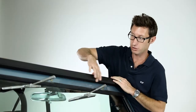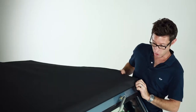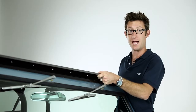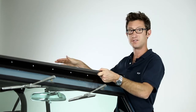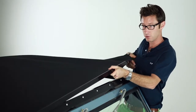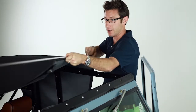You've got a metal lip that goes across the top of the windshield frame, and another metal lip that's attached to the top. Go ahead and pull the top forward slightly, pull that down, and it slides right out. Before you let the top fold back, you want to actually remove this metal lip. Doing that allows the top to tuck nicely in the back of your truck, so you don't have to actually take the whole thing off. All you need to do is just pull the top towards you, hold the metal lip in place, and the lip will slide right out.